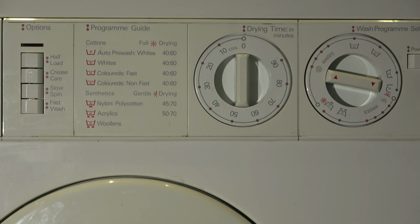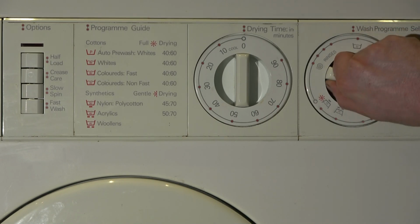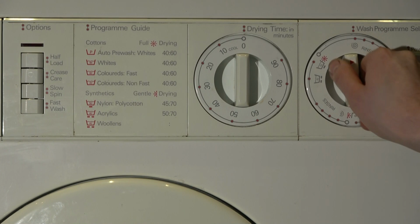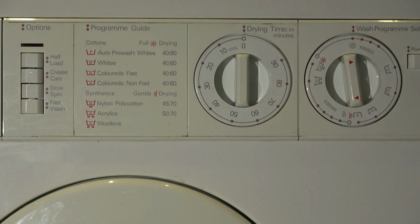Looking at the drum size, we're probably thinking it's either 4.1 or 4.5 kilogram, just like a Hotpoint. And likewise, drying will be 2.3 kilograms. It does 3 rinses with intermediate spins, and then a final spin here, which is very long. It's actually about 15 minutes long. It does bursts of spin rather than a full, long spin. But on the final stage of the final spin, it will spin at its max speed for about 5 minutes, which actually equates to really dry clothes.